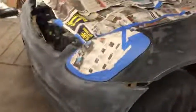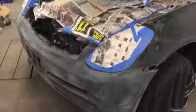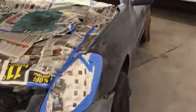Now that it's all prepped after 2.5 hours worth of sanding and taping and metal spot filling, I'm gonna try to hit the roof, hood, and trunk tonight, but if not, it'll be in the next video. But now I wiped it all down with acetone, saved you guys the time of watching all that boringness. And now it's ready to be shot green, so let's get started.